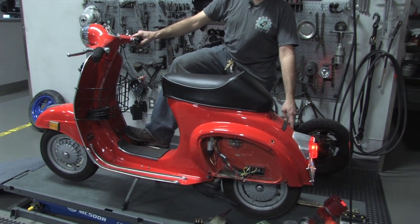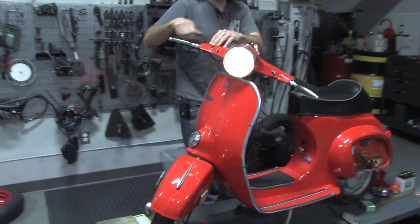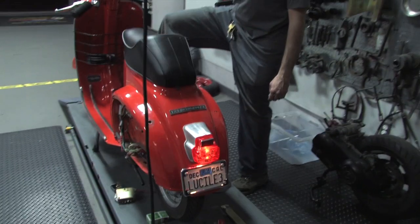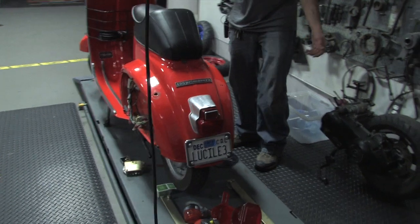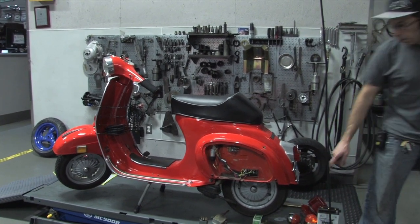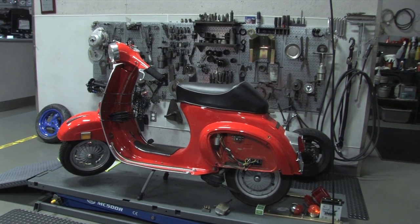I hit the brake light — it's nice and bright now. Hear the horn. It doesn't sound all that good because it still has the DC horn. Then you turn the headlight on — second position. Got high beam and low beam. The taillight is functioning just fine. Brake light still works good. The horn doesn't sound all that good, but if you put an AC horn in there it will sound pretty good. So it's a nice simple mod for somebody who has one of these bikes and wants to ride at night without having the headlights go out on you. The part you'll need: two part number REG6V — these little rectangular regulators that bolt with a single screw. I actually use a slightly longer 5mm screw to hold them to the frame. Thanks for watching.